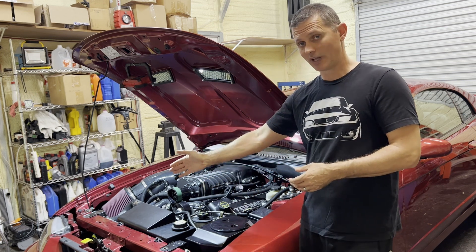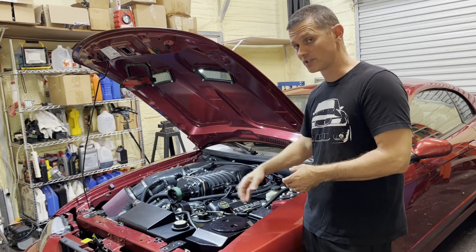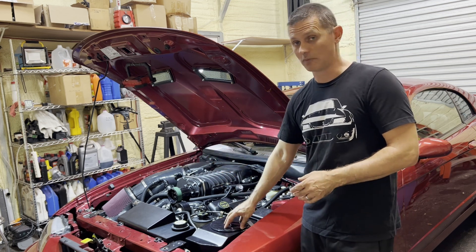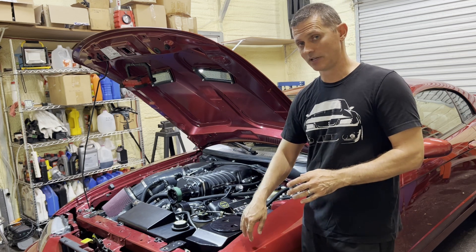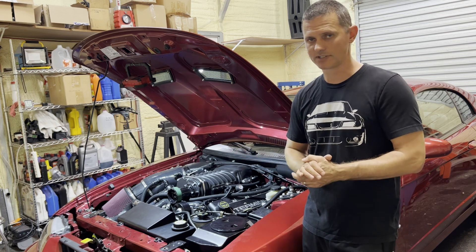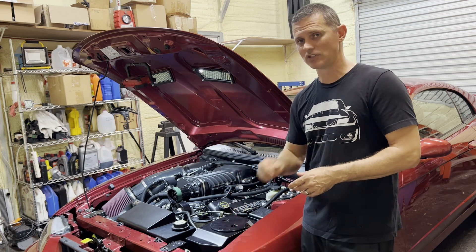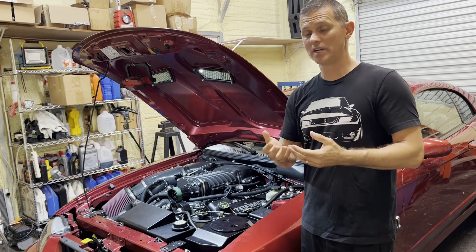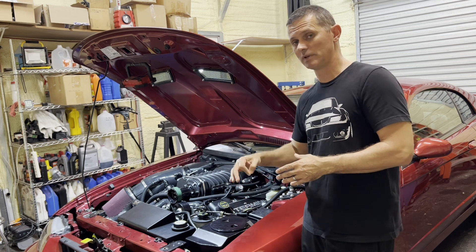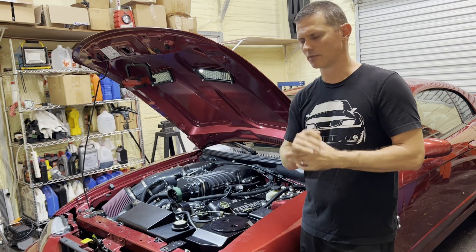We have one-inch bungs welded into the heat exchanger, and I can tell the core has been modified or swapped out — there's been changes there. We should have really good flow, but maybe we don't. The flow sensor is telling us we're not cavitating, at least not in our rolling runs. However, I never calibrated that sensor to an actual reading in gallons per minute, so although the pump's not cavitating, that flow could be really low. I need to calibrate that on the MS3.